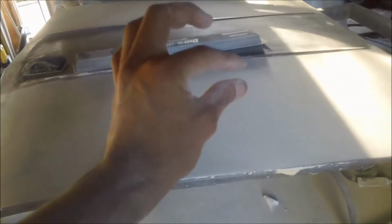And yeah, it does seem like a lot of filler, but metal, metal, metal, starting to be metal. All the edges are metal. But the trick is to keep it really, really thin and not have it fender in a can, you know. Do multiple thin coats of it and you should be okay.